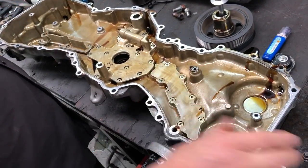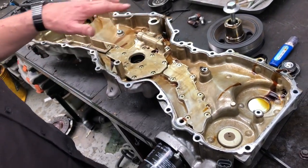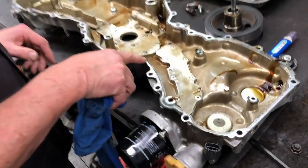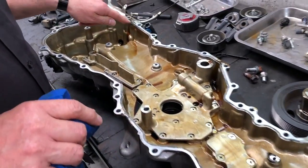Now in the old EJ series, it was a plastic timing cover with a belt, whereas the new model engine has now got a chain or dual chains. What happens over a period of time on this particular engine is the silicon seal around the front of the timing case does tend to leak.